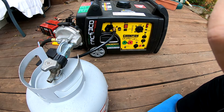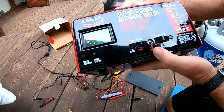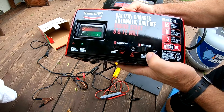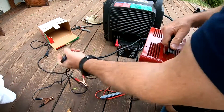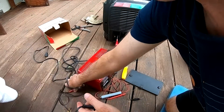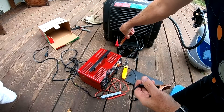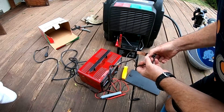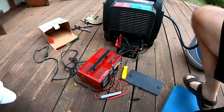We may have to replace the battery — that's possible. This battery charger has an automatic mode where it'll send two amps to the battery, and when it gets to 100% charge, it'll shut off automatically. This doesn't have an on-off switch, so you always want to hook up the battery connections first, then plug it in — that way there's no sparking. Put the red on red, black on black, then plug it in.